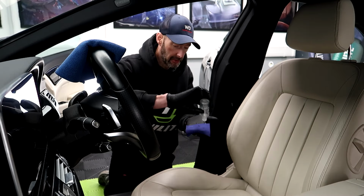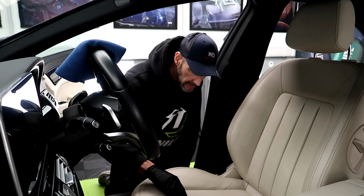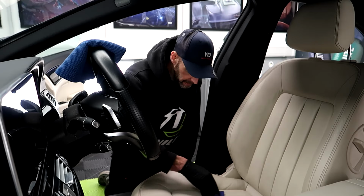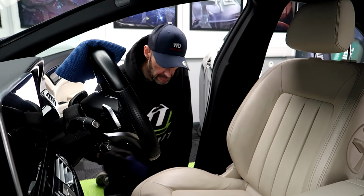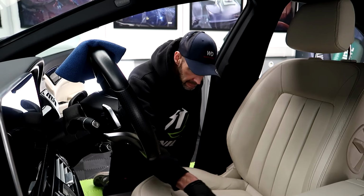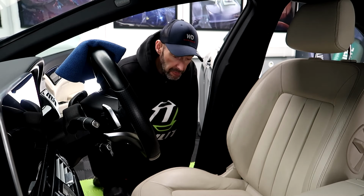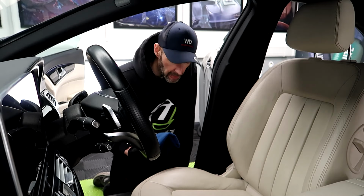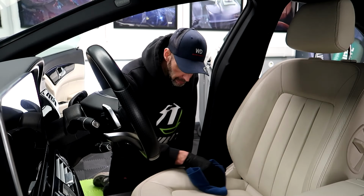Take the suede cloth, load a little bit up on that one. This is going to allow me just to get into all the gaps. Just go over everything twice. And then I will finish up with the microfiber applicator, just to even everything out. Then I'll leave that for a minute or so. And then I've got my Gyeon Bald Wipe. This pretty much bonds almost instantly, so literally no pressure. Just gonna wipe off any excess.